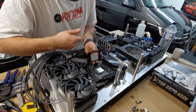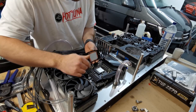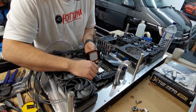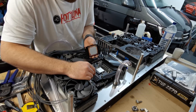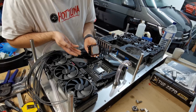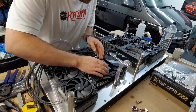The other thing is if you do it like this, you've got a bit of a messy edge here, but whenever you pull off a CPU from the socket and it's filled with thermal compound you have to mess around trying to clean it up. This approach is just going to leave it very clean on top, so when it comes to replacing it or cleaning it up it's much tidier to work like this. It's easy to clean the block because you don't have to worry about compound falling into the CPU socket.